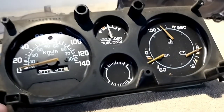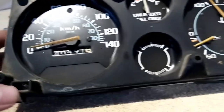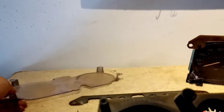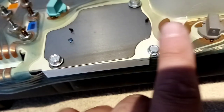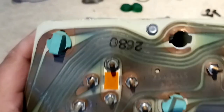Then there's your backing. As you can see, the gauges are like brand new except for the discoloration of the needles. Your glass is always the problem — it's so fogged up, and most of these plastics do fog up. There is a way of restoring them and I'll show you later. To take this plate off and turn it over, you would have to take these bolts out — one, two, three, you can leave that one in, and then four, five, six little bolts to take out.